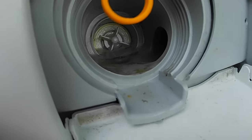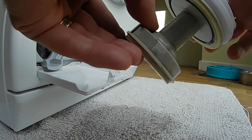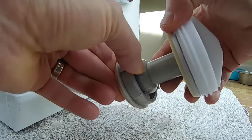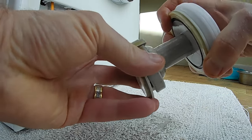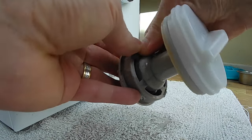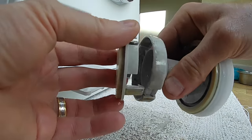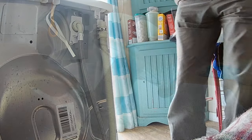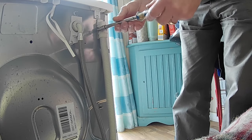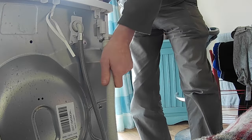There's a little impeller at the back — check that it turns. It should be a little bit resistant, a little elastic. Mine turns nicely. Take this bit apart by pushing the tabs on the sides slightly out. Make sure that's all clean and nothing's caught in it, then push it back together again. Take off that pipe — you can use a 7mm socket or a screwdriver.